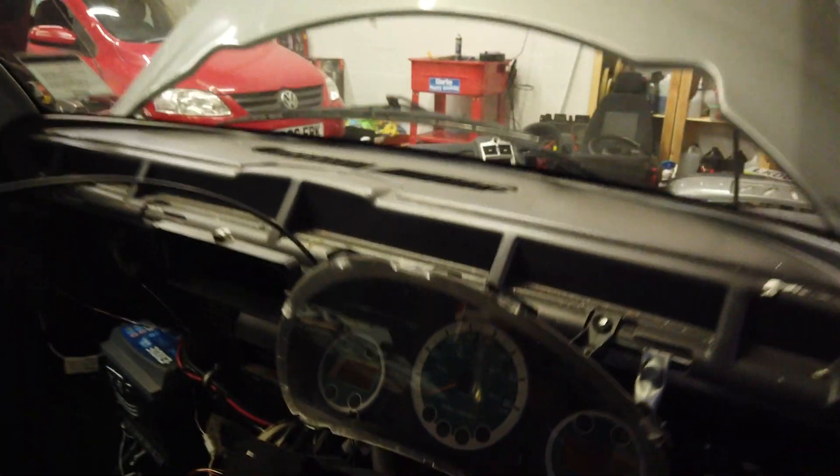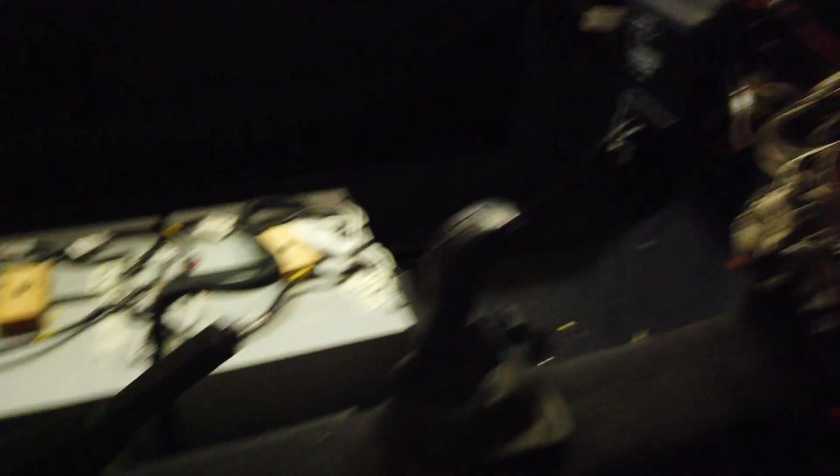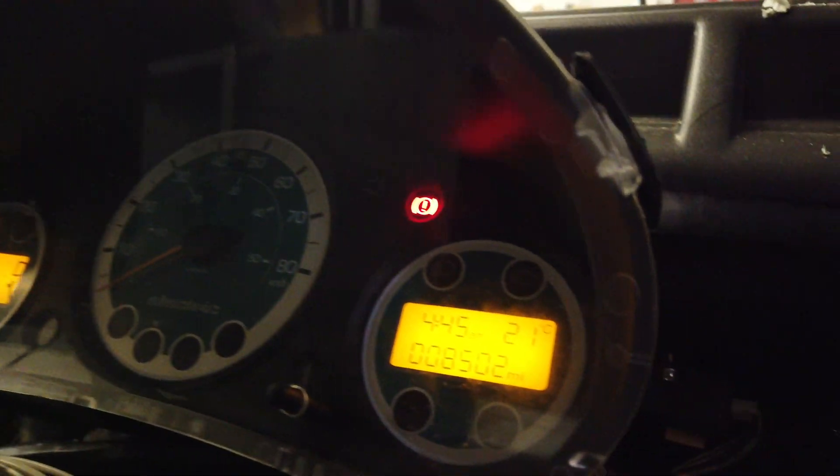This car's only got 8,500 miles on the clock — we now have some life in the clocks and you can see the mileage: 8,502. So it's at least on its second set of batteries. From the rudimentary tests I've done on the voltage and the fact the batteries aren't that old, I reckon we might be okay on the battery front. It doesn't seem like we've got any dead batteries amongst them, so I think the problem likely lies with the charging.